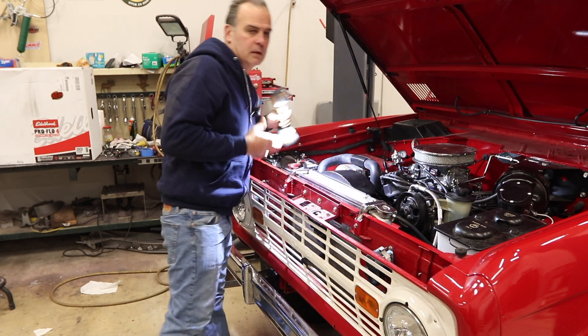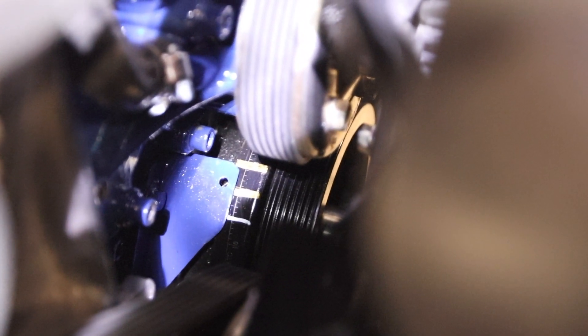I'm on my compression stroke, so now I can finish getting that exactly to 12 degrees. You can see the harmonic balancer — what I always do is mark white as zero degrees, and then put a gold Sharpie every 10 degrees. So you can see I'm a little bit past the first 10 degree mark — that's about 12 degrees before top dead center.